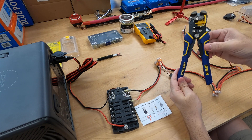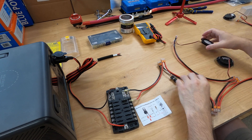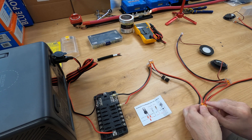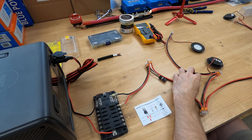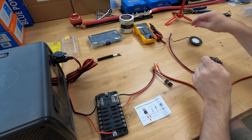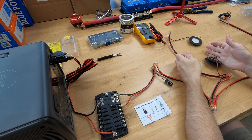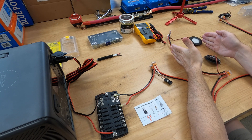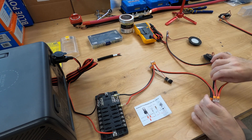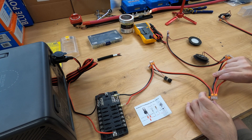Let me introduce you to the Irwin wire stripper — you'll love this tool. Now we go on to the lights themselves. We'll follow the positive and negative here into these lever nuts, and the main trunk continues here and on out to the next set of lights. They actually come in to the middle — these two lights are in series while the whole thing is in parallel, so parallel-series. Imagine this is one bay with a ceiling panel between ribs, and this is another bay. Each one of these bays you can disconnect at the main bus of this wiring if you need to take a ceiling panel down, do some work, or replace a puck.